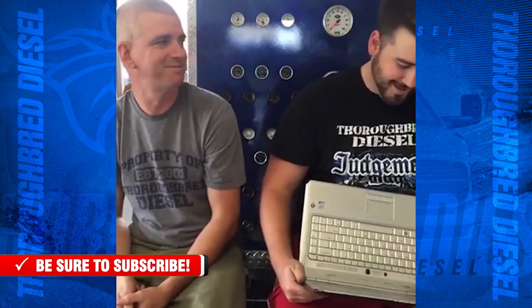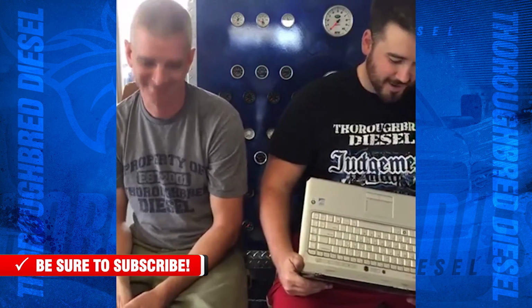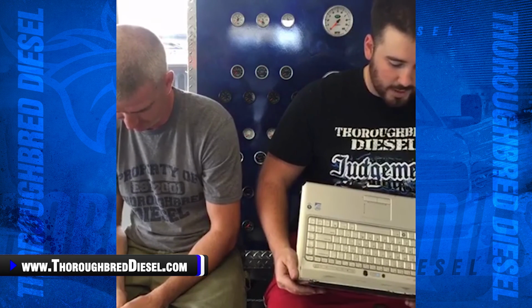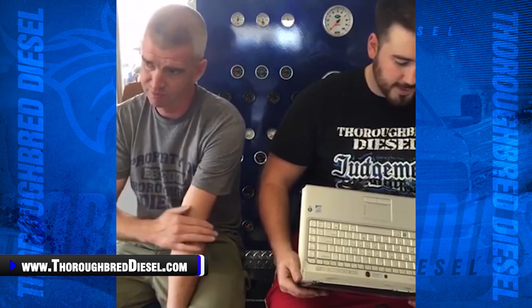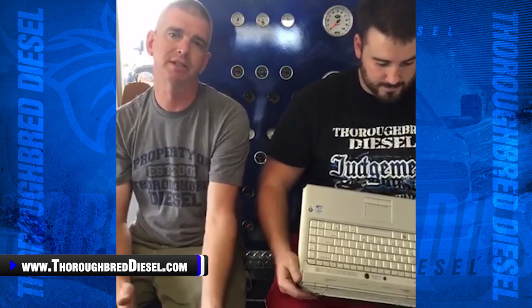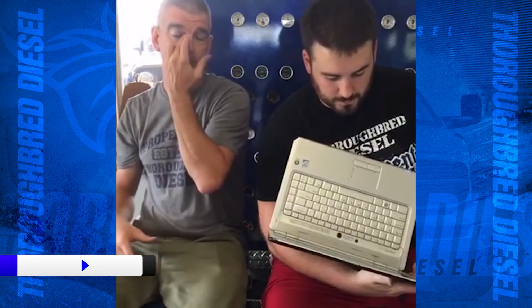All right, 2012 Cummins riding down the road. Trailer service light pops up, and TCS seatbelt security light. Turned it off, wouldn't turn back on, had to take the battery cables off, and it started. More than likely, it's probably the ECM, or it could be the integrated power module as well. Those are two big things, and they're both known failures on that year Dodge.